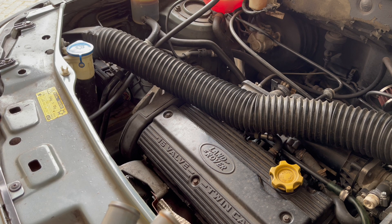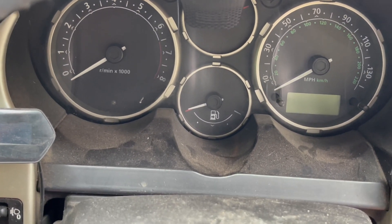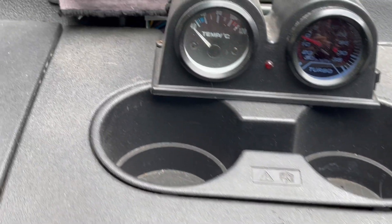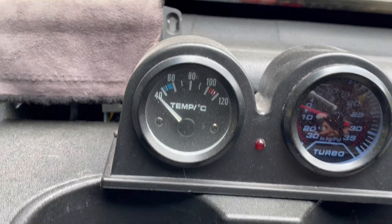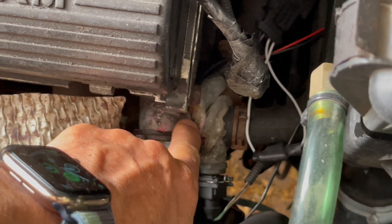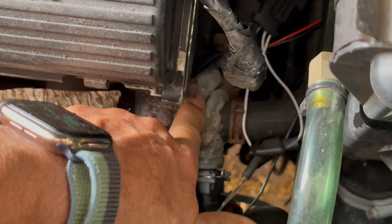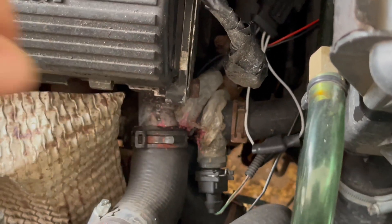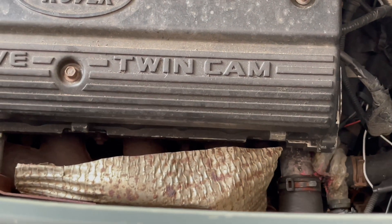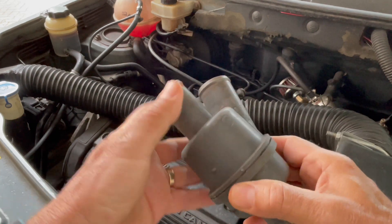Most of the time you won't know you've got this problem because the temperature gauge in the car reads normal when the engine temperature is anywhere from about 60 degrees up to about 110 degrees centigrade. What you really need is a much more linear temperature gauge — here's one I've put in with a separate external sensor placed right next to the hot water outlet pipe from the engine, covered in insulation so the air doesn't cool it, reading the actual pipe temperature which is pretty much the engine temperature, without drilling any holes in the water system.